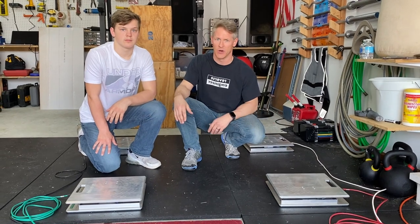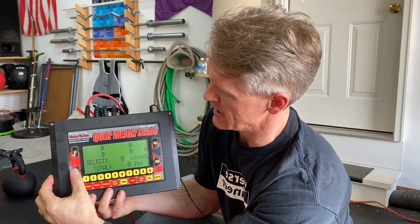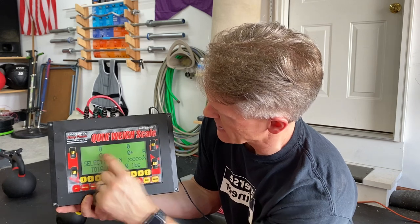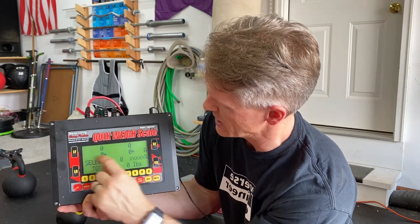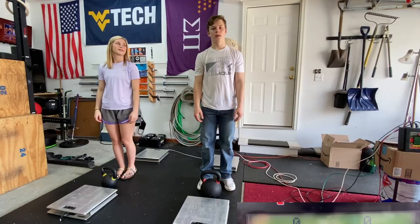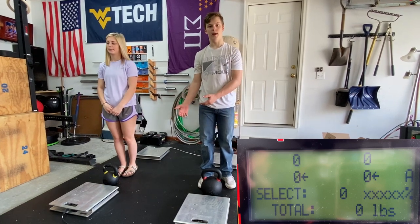If you're going to be weighing a car, you'll want a nice set of scales like these. These car scales have a feature where they display the percentage of weight on whichever pad you select. You can select the left rear and right rear — these are your individual pads — and it shows the rear weight percentage with both rears selected.